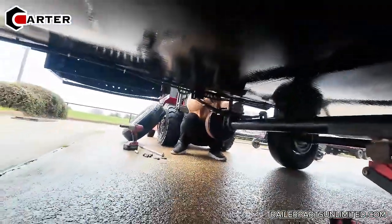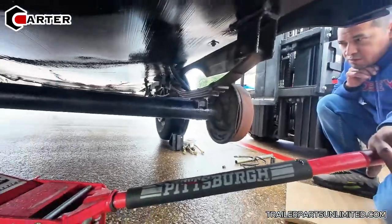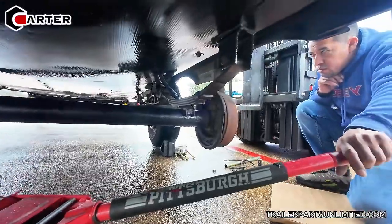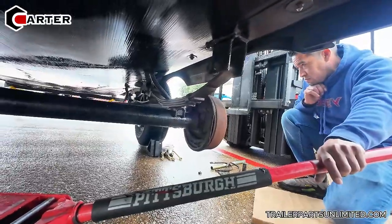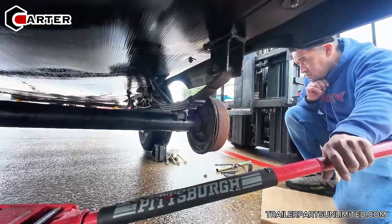Alright, so Danilo's just taking off the U-bolt on that side. Yeah, so it's a 4-leaf spring. I'm thinking those springs are just the 1750 springs. I mean, they might be the heavier ones, but the leaves are a little thicker and rated for a little bit more weight. Maybe rated for the 4,400 pound axles, but.